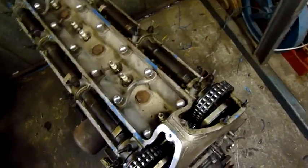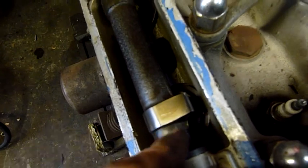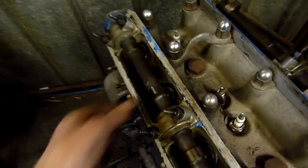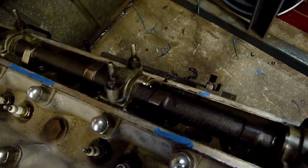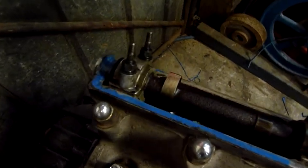Apart from all the nasty oil, the rest of this looks pretty reasonable. The cams are very worn - that one there especially, not even evenly worn. But still, nice pointy cam lobes, in really good condition visually. As far as tolerances are concerned, it's not so good. These just run on the followers or shims - no tappets, no rockers, no nothing. They're just straight over the valves.